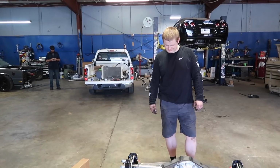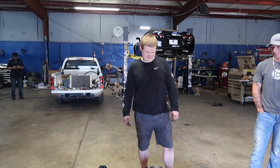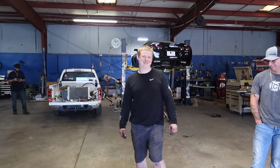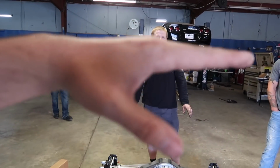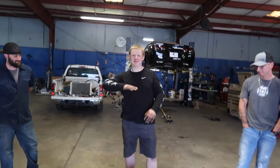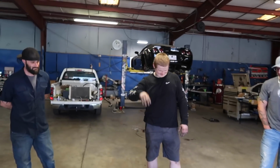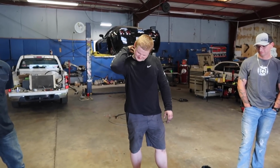They will when this thing separates half track. 12 inches of separation. That's too much. 13 inches of separation, drive shaft falling out of it. That's way too much. The tail shaft on the transmission is going to articulate. It's going to have to if it does that much. I'm going to have a universal joint halfway through my tail shaft.